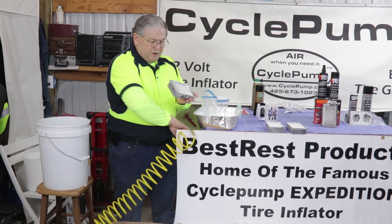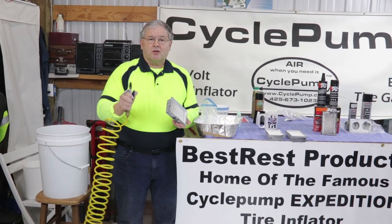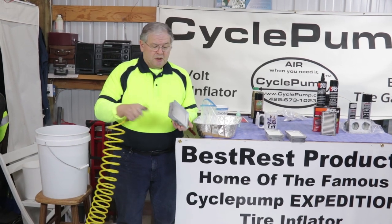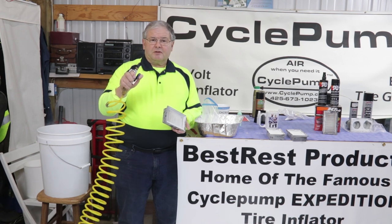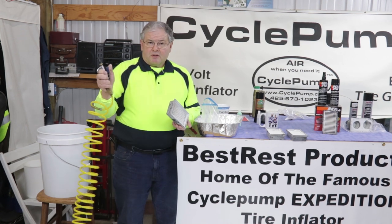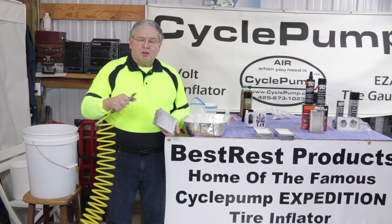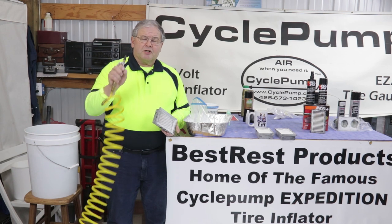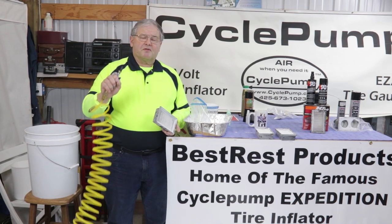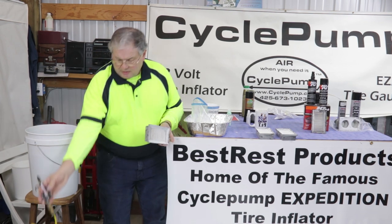If you were at home you could use an air hose, but I'm assuming you're not going to be at home — you're going to be on top of a mountain. You could blow this out and get rid of most of it. Don't do this with a K&N filter. According to the industry guide we worked with to help prepare the films, blowing a K&N air filter with high pressure air will tear apart the fibers and reduce the efficiency of the K&N. So air hose, high pressure — no go for the K&N.